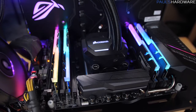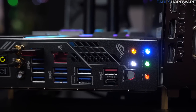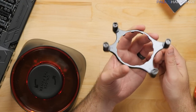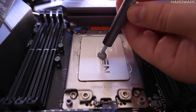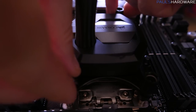For the Threadripper system, I have the AMD Ryzen Threadripper 1950X, 16-core, 32-thread CPU, paired with the Asus X399 Zenith Extreme motherboard running UEFI version 0401. For CPU cooling, I have the Corsair H100i V2 240mm all-in-one liquid cooler. I used the TR4 bracket that came with the CPU to see how a middle-of-the-road 240mm AIO cooler would work, since that's probably the most common setup. I also used extra thermal paste to maximize contact between the cooler block and the extra large Threadripper heat spreader, to get coverage over all four CPU dies, even though only two out of four are actually functional.